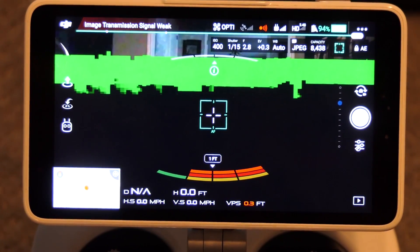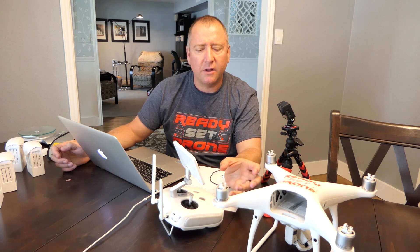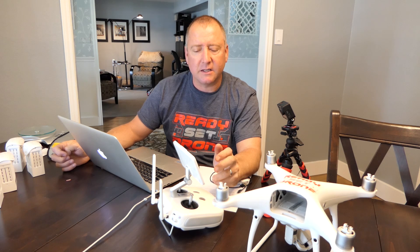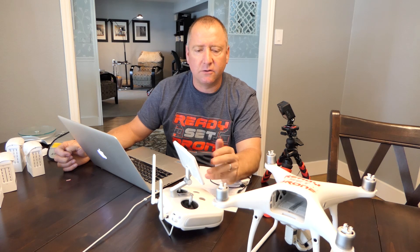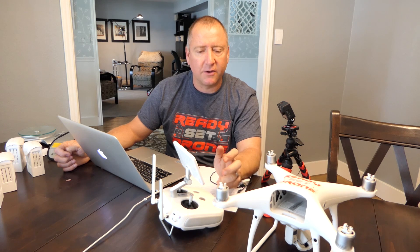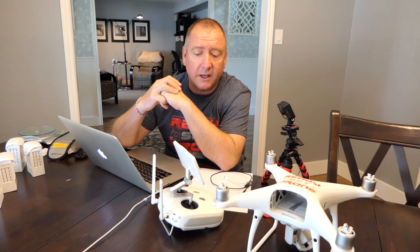I couldn't figure out what was going on. I updated using DJI Assist 2 to the latest version, but I was never really clear on how the controller got updated. I thought the two talked to each other wirelessly, and when you updated one, the other one updated automatically. But I guess that wasn't the case, because I spent a lot of time trying to figure out why the bad signal was happening, even though it said I was on the latest firmware. I went into the frequency settings, changed it from 5.8 to 2.4, which didn't seem to help — I was just getting a really bad video signal, lots of interference. I posted that video yesterday and had a lot of people tell me I needed to update the actual controller.